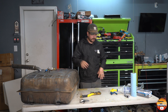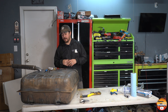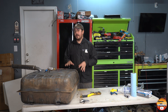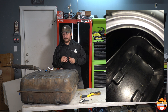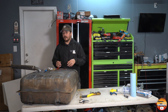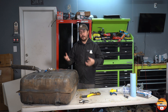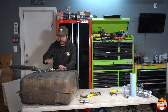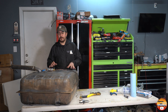I just finished cleaning up this tank for our Suburban. We degreased it and we're going to paint it with some cheap Rust-Oleum paint just to protect it from rust. We got pretty lucky - our Suburban is a 1987 Chevy Suburban, meaning the original equipment actually had a fuel injection tank. It has a plastic baffling system or sump, and basically why you'd want that in a fuel injection setup is because when you accelerate, all that fuel is going to slosh to the back of the tank, or when you're braking, it sloshes to the front. If you're running on a quarter tank or less, your fuel pump might suck up some air during that transition period. Chevy in '87 when they switched over to EFI basically just grabbed a tank, modified it, installed those sump systems in them, and they seem to hold up pretty well for fuel injection purposes.